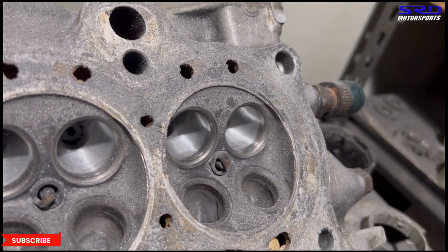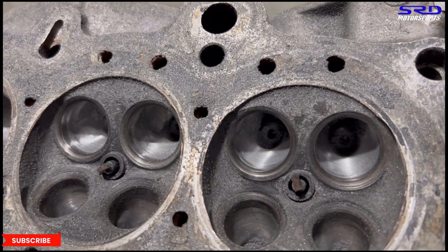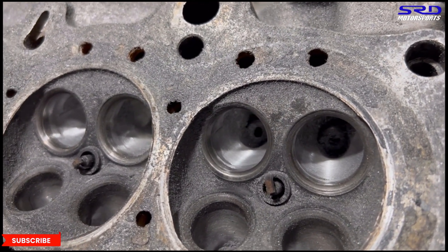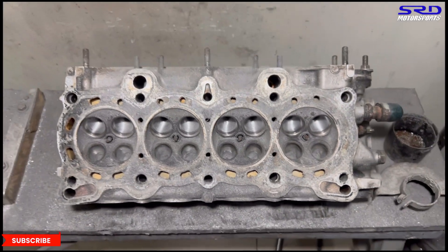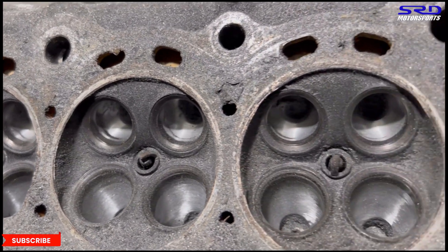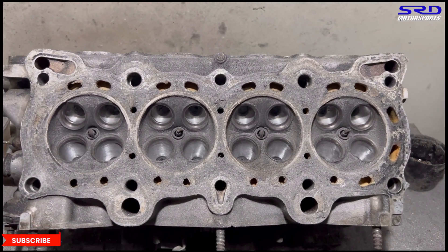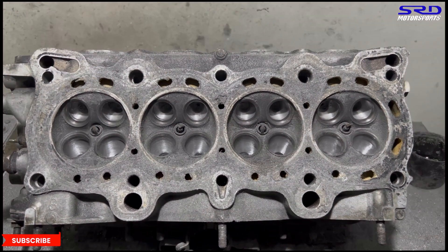You can see the intake bowls have really gotten good — the texture and finish we wanted. It's at 120 grit. You can still see the core shift there on the left side. We can't really remove that — if you remove it, you're going to skew the port shape really bad. It would look good for social media, but not really. Here's the exhaust side — the bowl has gotten really good too. You can still see the core shift. Even on a proper CNC head, there will be areas it didn't touch because the core shift went too far. We'll work on this a bit more off camera, then wash it and take it to the workbench.